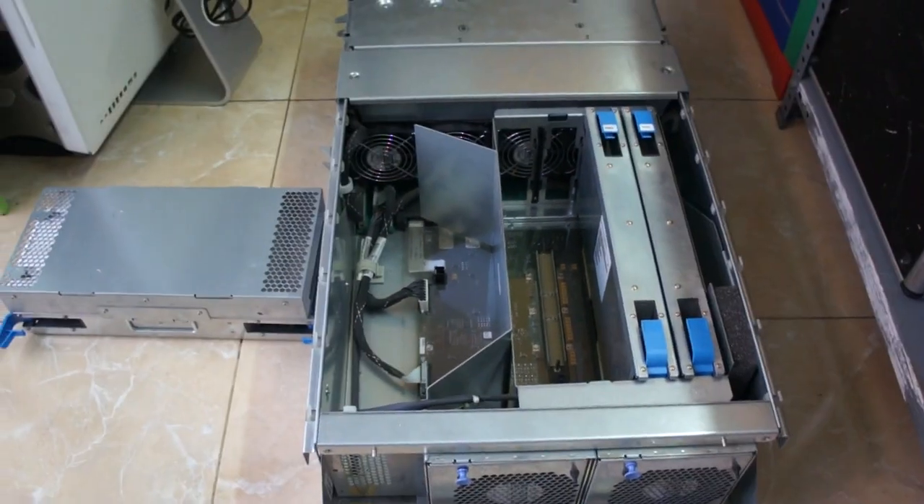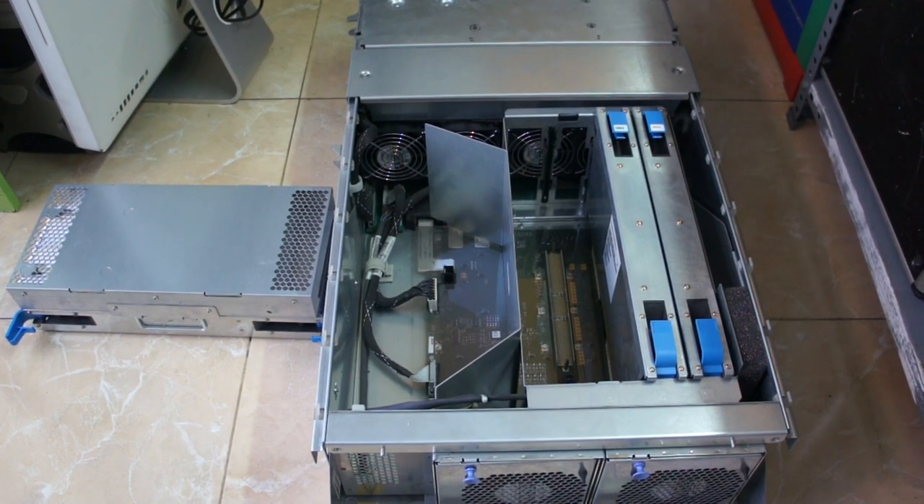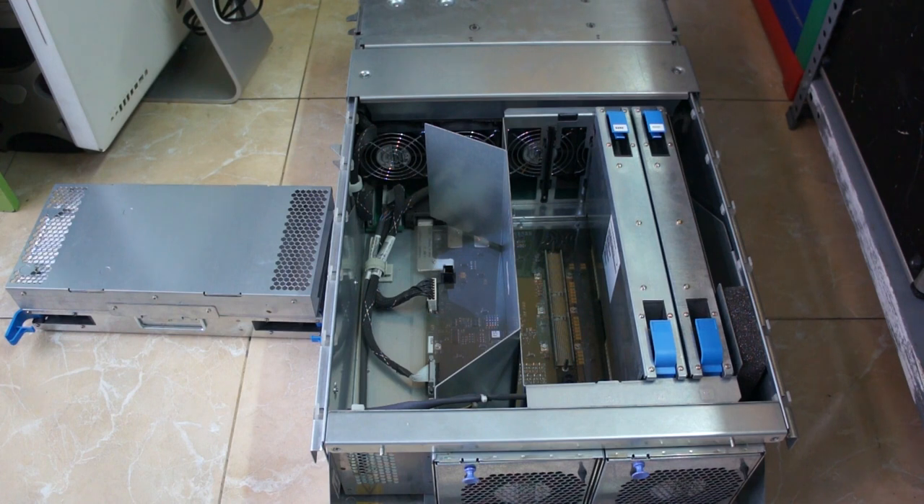I'm going to be taking apart this CPU module in another video, which I'll probably shoot later today, because this thing is a piece of art in and of itself. Look at that connector — that is just glorious, just ridiculous. These two parts are actually interconnected using a compression connector — the kind that gives all those problems in the SGI machines. There's actually nothing down here on the board apart from those huge bus boards. That's about it for this system: the IBM eServer pSeries 660 model 6H1. I hope this gave you some insight into what IBM Big Iron pSeries systems looked like back in the late 90s and early 2000s.